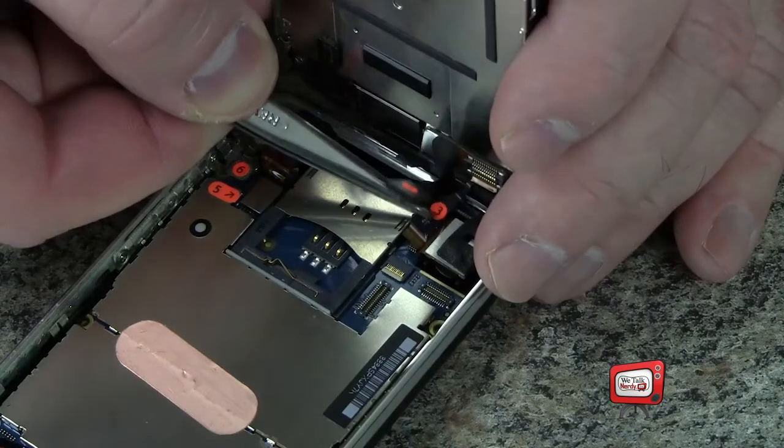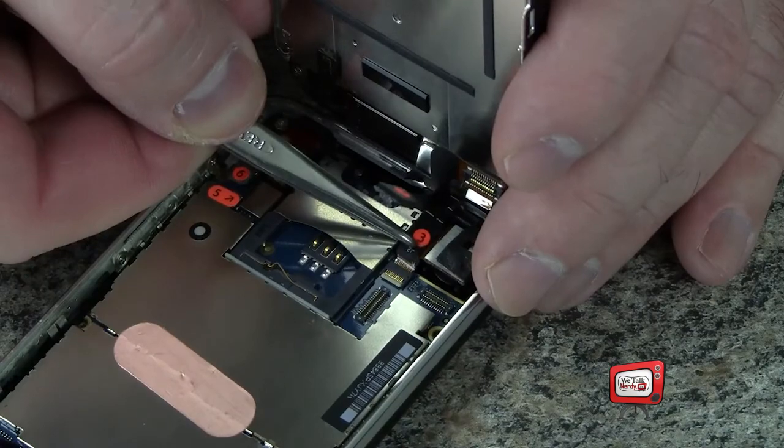Then reattach the cables. Cable 3 is a small ribbon cable that slides into a connector on the main board — tweezers can make it easy to put it back where it belongs. All the other cables are just press-fit connections; again, you should hear a small click as it snaps into place. Gentle pressure is all that's required. Once you have reassembled your iPhone, plug it in, charge it up, and then test it to make sure that everything is working properly. In particular, you should test the camera to make sure that it's connected right as well. I suggest that once you've charged the battery fully, you drain it back to zero and then give it another charge for at least 12 hours.